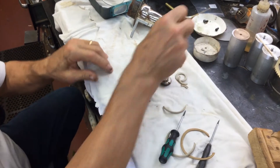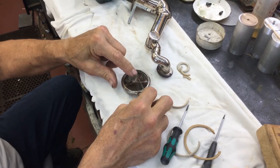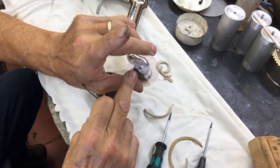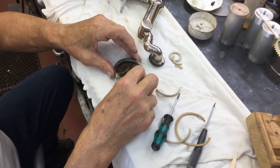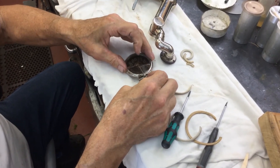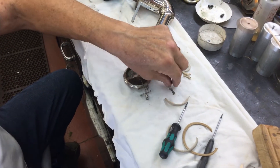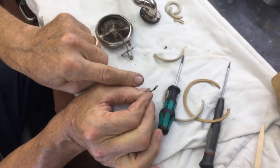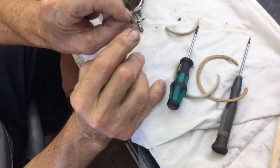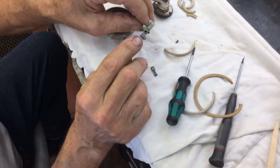Before you put that last gasket material in, you're going to hook up the needle bar and align the hole in the end of the needle bar to the hole in the middle of the mica. You can see the hole in the middle of the mica. After you get this aligned and you've flipped it over and added the screw, then you will put the two springs in. The springs have two sides — you can see here we have a little bend. So the screw goes in this end, and with the bend it puts tension right here on the needle bar.